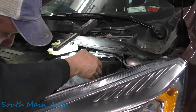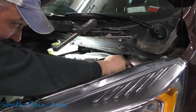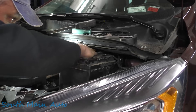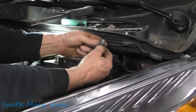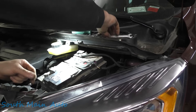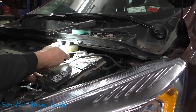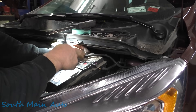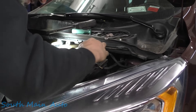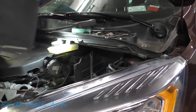We slide it ahead. We get our battery cable coming this way, get our wires coming this way. What you have to do now is unhook the battery current sensor. You've got to push on the release tab which is right here on the back — give that a push with your little finger, set that to the side. Then you get back to where you can unhook the negative terminal. Easy peasy. This car has start-stop technology so it uses an AGM battery, group 48.